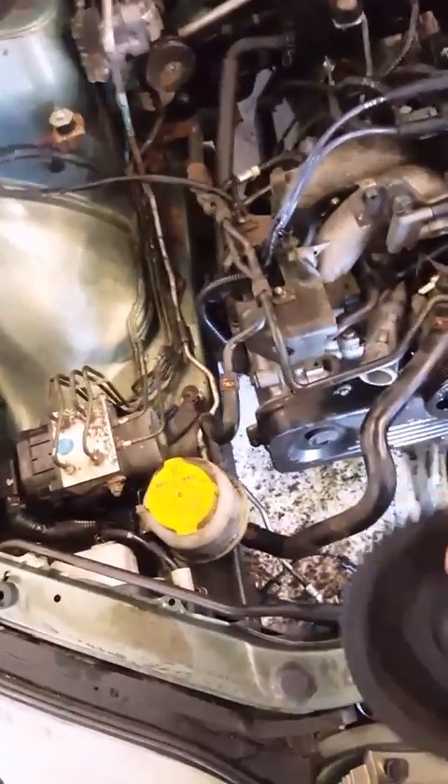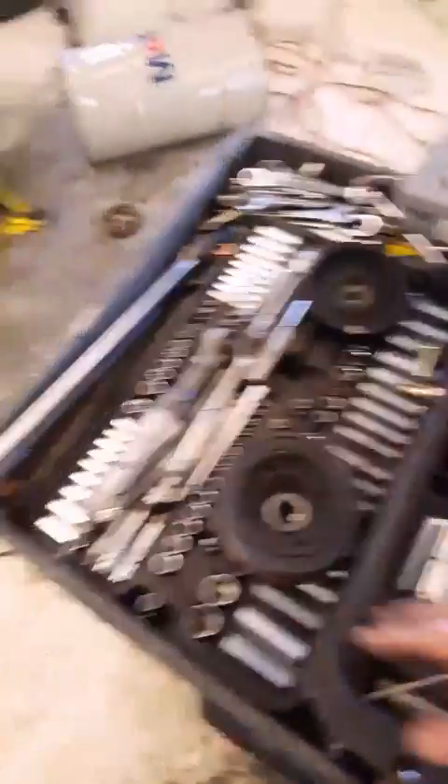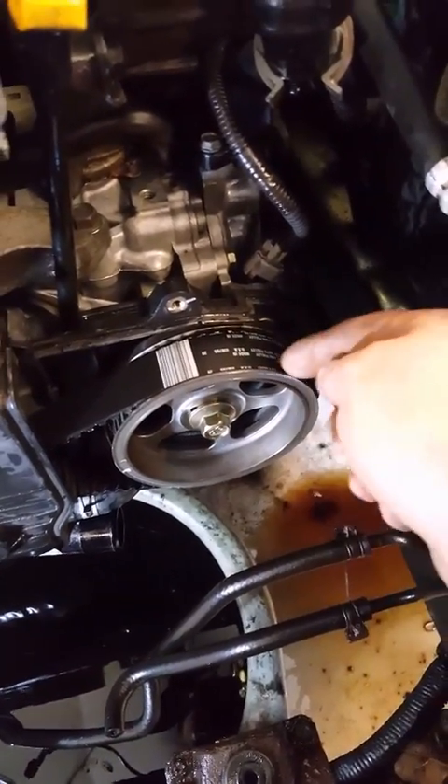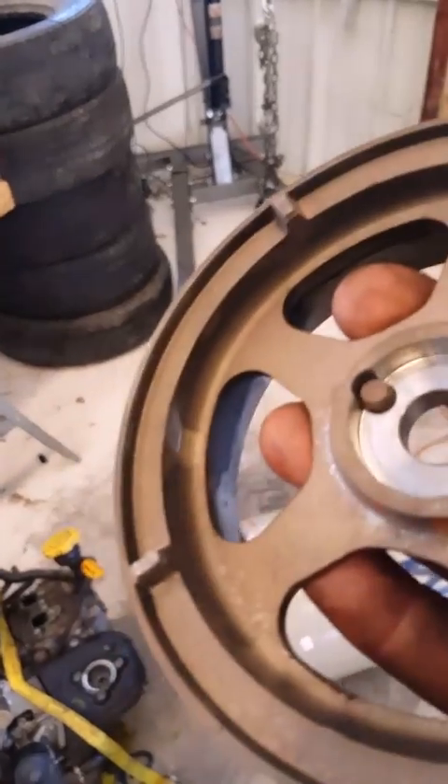This guy right here is the engine right camshaft pulley — it's actually the same as on the 2.5. I just swapped everything over just to keep everything together. However, over here on the engine left, this camshaft gear has to be swapped. This one, being the gear for the 2.5, has many more notches on the back that the camshaft position sensor pays attention to than this one does — this one only has two, while that one has five or six. So you're going to want to swap those out too.